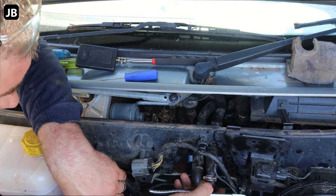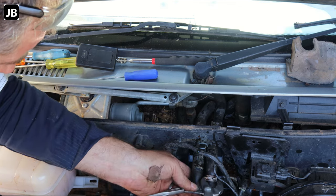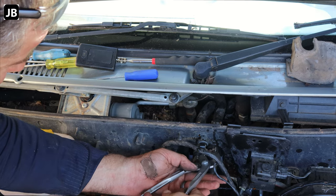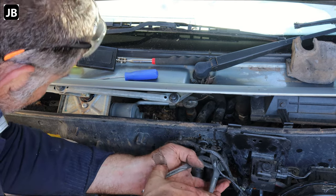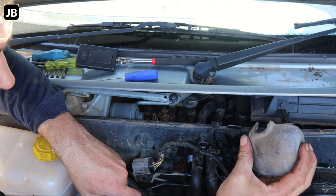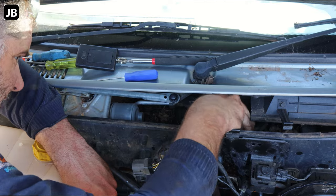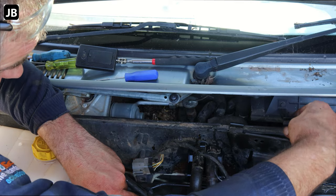I found that a pair of water pump pliers is the best bet for these spring-loaded hose clamps. If anyone's got a better idea, leave it in the comments below. And now it's just this little rubber cover that fits over the connector on the inside, making sure that it keeps water out of it as far as we can. And that just slips into place over it. And now we can get all the trim back.